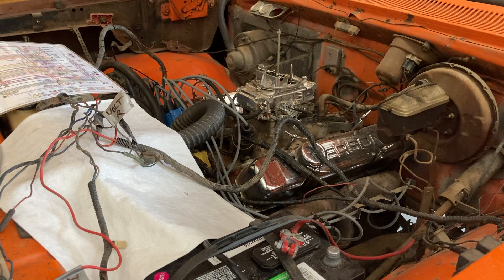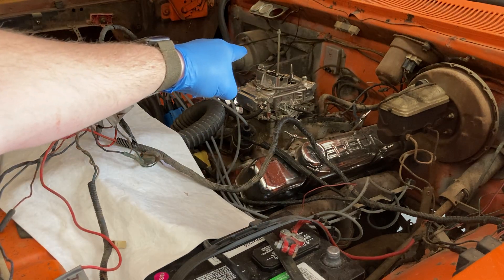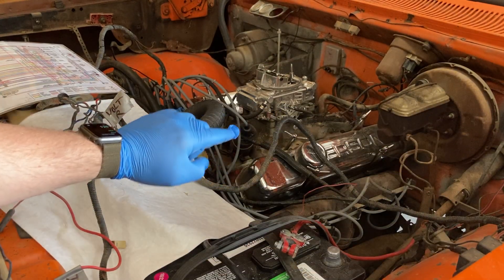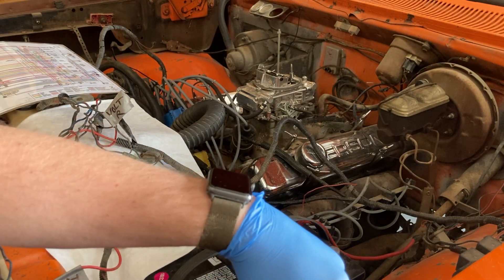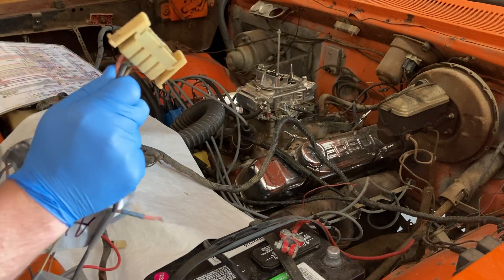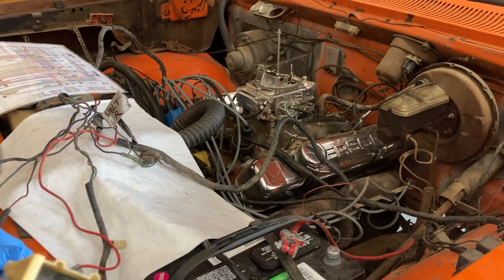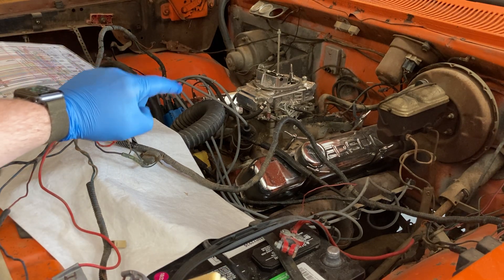This is where I started, and what I found is that there are two voltage regulators in this truck — one on the firewall and one on the fender well. My best guess is that this is a 1975 truck with a big block 400, but the VIN says it's a 318 car. I think as a utility truck they dropped in a salvage 400 big block, then with all the CB radios, speakers, and light bars they quickly realized they didn't have enough battery power, so they went from a 60 amp to a 100 amp alternator.